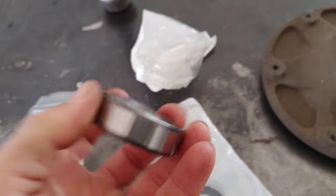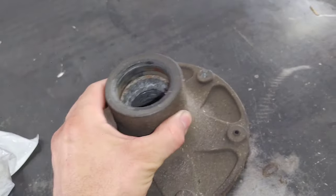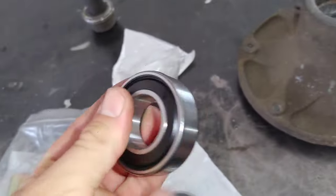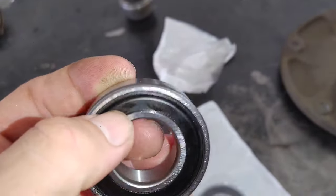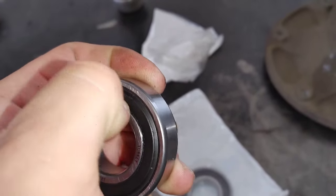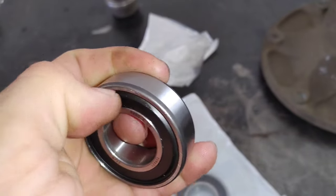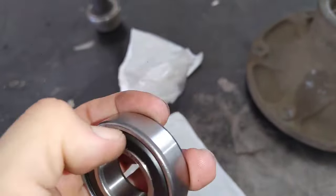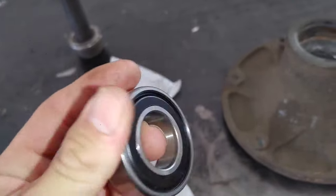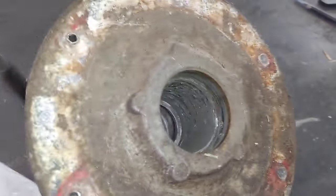And one other thing I want to mention before wrapping this video up, this is a spindle off of one of my customers that has, it's a commercial Toro. And I've rebuilt a few of these spindles for him, and he brought me these bearings, and these bearings are sealed a lot better. And this is what my fingernail is touching right here, is metal. I cannot pick this seal out of here. There's no way I could ever do it with my fingernail like I can with those other bearings. It would take quite a bit of effort, and there's no way to actually grease this spindle.